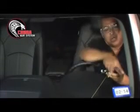Now, this opening here that you see here, I want to make sure that I face it on the corner, so this way as I'm making my cut, it doesn't go against the edge of the Cobra and create resistance. I want to have less resistance, so I want to have open space, the window. So I'm going to turn it here, facing the corner, and as I can see that the cord is okay, I'm not going to be putting it under a bind on the tool on itself.